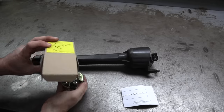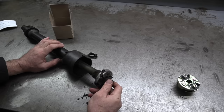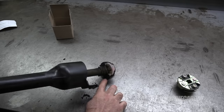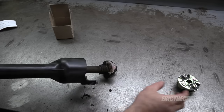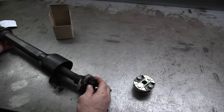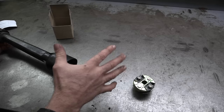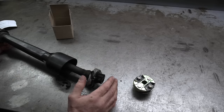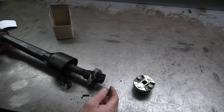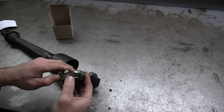Here's my new rag joint — I will link this in the description for you. I just pull this out to extend it. Now this one is riveted on; you can sort of see there are rivet heads here. I'm going to need to grind these rivets off and get them out. You could also drill them if you needed to. And why do they do this joint? Well, when you go over bumps, the entire suspension is jiggling and moving around and they're trying to avoid transmitting that up to the steering wheel. So this is considered something of a shock absorber, so that as you go over bumps, not all of that is transferred up to the steering wheel. Over time they get a little worn — it's basically made out of the same kind of stuff a tire is made out of.